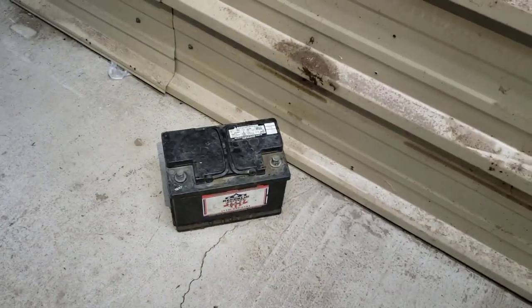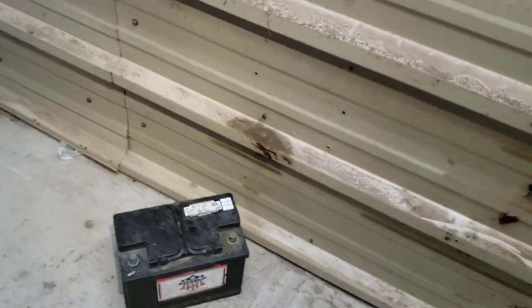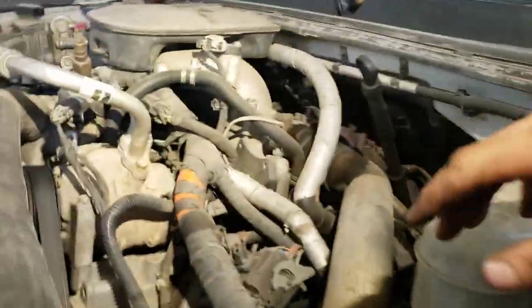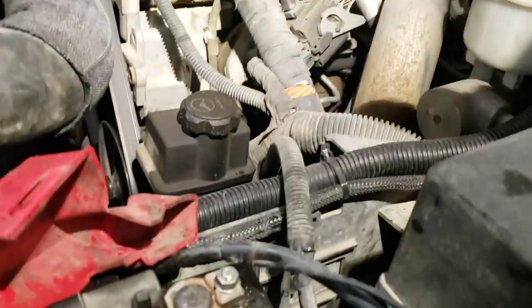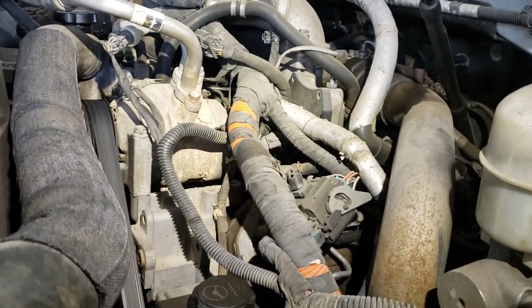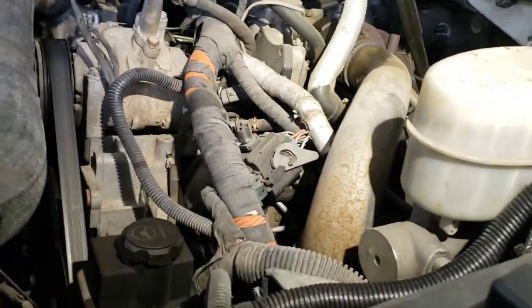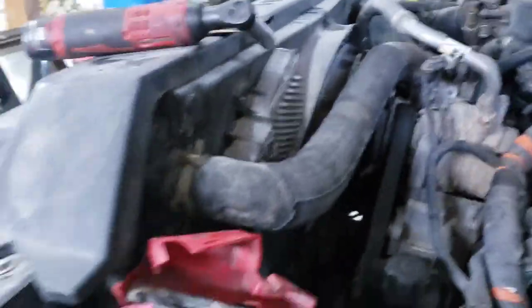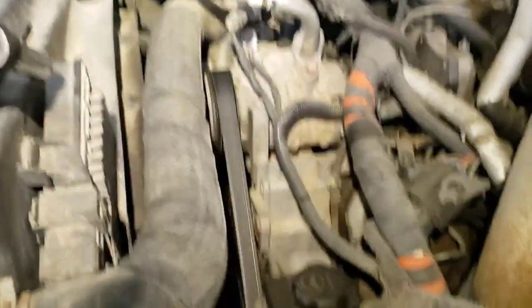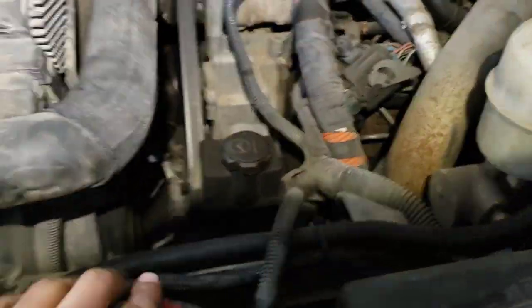With all that, I don't know if it was this battery - this is just an extra but when I put that battery in, it had been sitting around for a while. I don't know if it shorted out or something because at the same time - this is a diesel engine - my oil pressure sensor, my oil pressure gauge quit working. It would be maxed out and now it's reading zero. It seems like it might be related since it happened right when I put that battery in. I'm just happy it didn't mess anything else up.